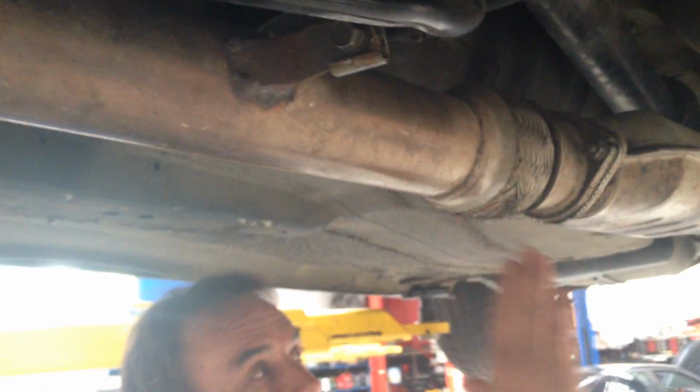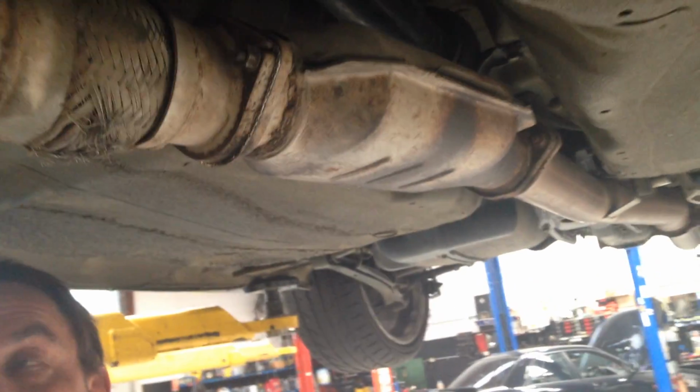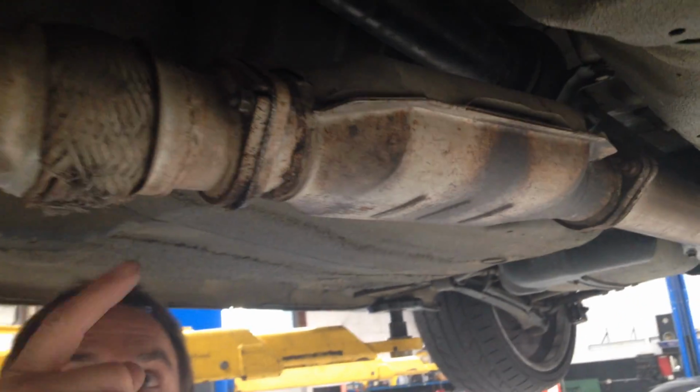You can see the gearbox has had a big birthday because it's all nice and new. This downpipe is still the same design we use these days. It's got the split collector up the top there, which I'll show you a still photo, comes down through a flexible joint. And this particular car, in those days, we were putting the catalytic converters in the center assembly here to bring the car on boost as early as possible. You can see it's had a little bit of damage on the bottom here, but a flexible joint, which now we use a ball joint, but still very similar design.